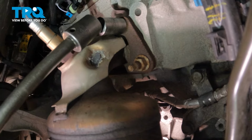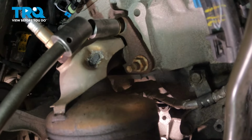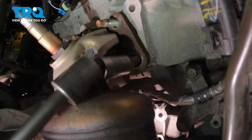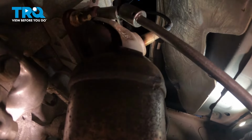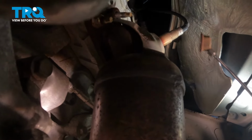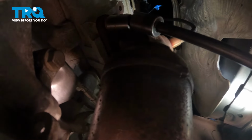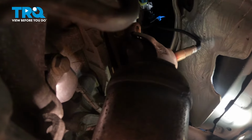Now we're going to take the nuts off for the manifold or the top part of the converter. I'm going to use a 15 millimeter swivel socket. And take the nuts off. Just use a magnet if you need to. And I'm gonna take the last one off. Make sure you support the converter because it's gonna be loose once you get this one off. Slide it out